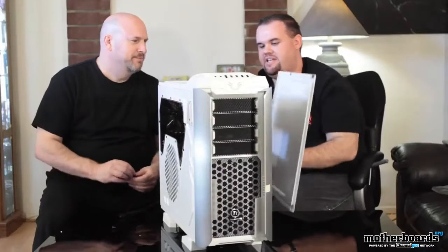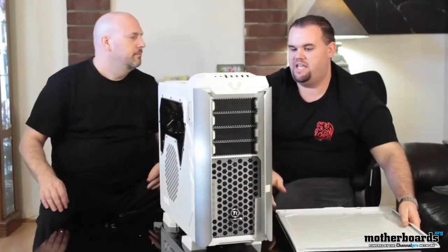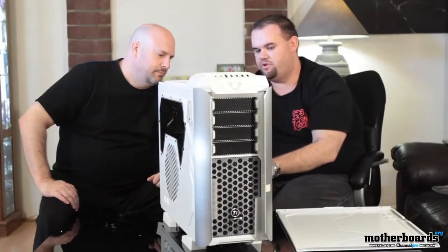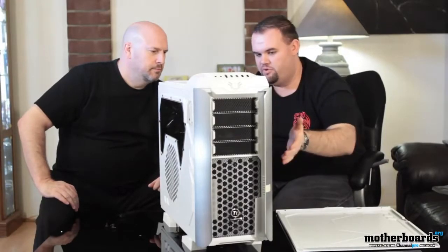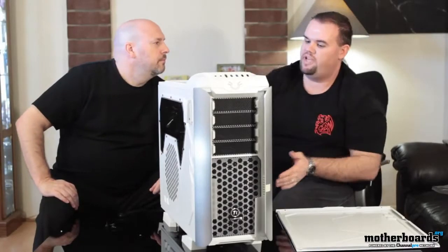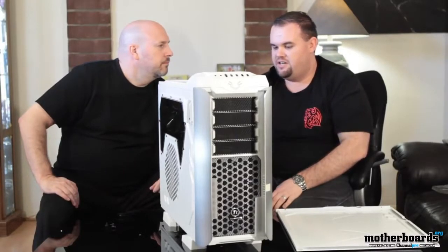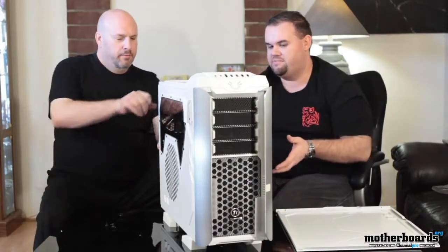Well, that's something you'll see, that there's not a lot of removable motherboard trays anymore, because when it comes to cable routing, when you're routing it to the front, you're tying everything up. So if you remove the motherboard tray and you have all your drives here, theoretically, you've got to be able to move those cables. We have very large pockets here for cable management. If you're routing all the cables through there and going to the drives, and you pull that motherboard tray out, where are those cables going to go? Right. You're going to have some serious issues there.